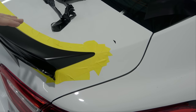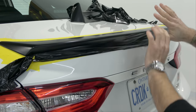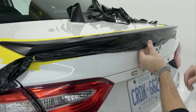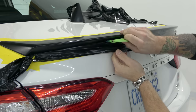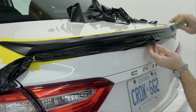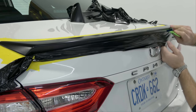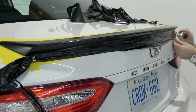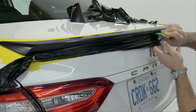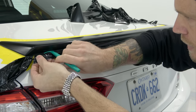This corner up here was a little bit jagged — I'm not sure if that showed when I panned across it at the start of the video, but that's more or less it. I'm going to go over this with heat on the top side afterwards — it's not finished yet. Let's do the bottom section of this spoiler. Normally you would have wrapped all the way around it first before any cutting. I just didn't want to keep moving the camera around too much. You always do the wrapping first and then your cutting. Relief cuts are fine — you need to do them sometimes.